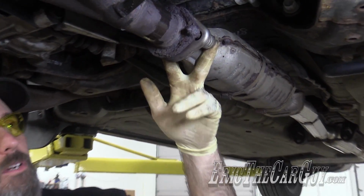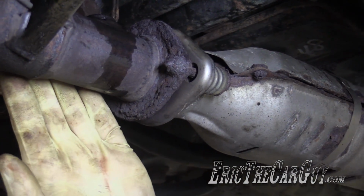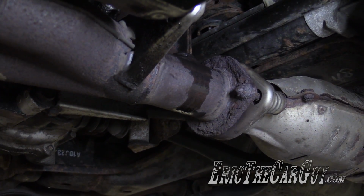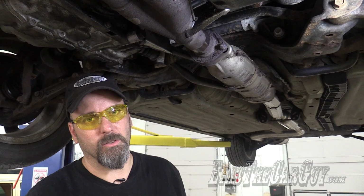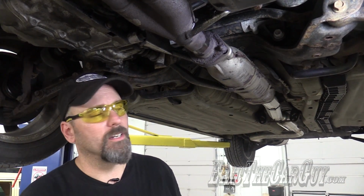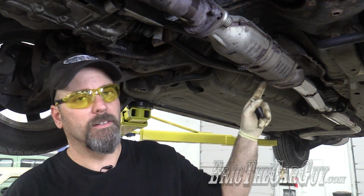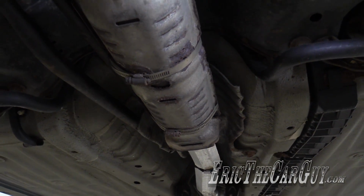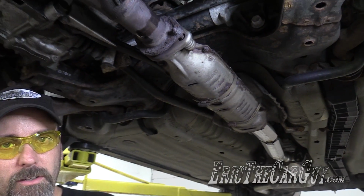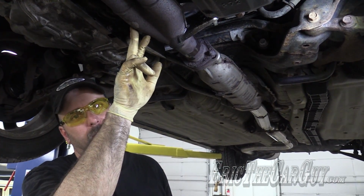That would be these two spring bolts here that connect the pipe to the catalytic converter. This is referred to as the A pipe. And just an FYI aside, GSRs are famous for this. If you have a buzzing noise at a certain RPM range, first check all the exhaust shields and see if they're tight. As you can see, I've hose clamped these and these are pretty much good to go. But if you still have the buzzing noise and you know you don't have any other issues, it's quite possible that this pipe is causing the noise.